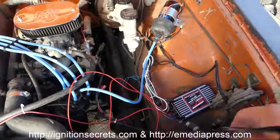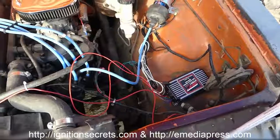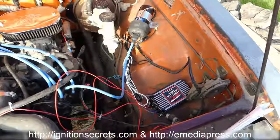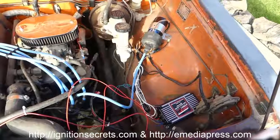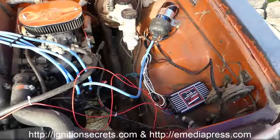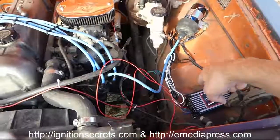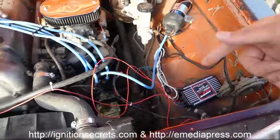And so what I'm going to do is take the cap in here, which is normally hundreds of volts, and normally it's thought to be impossible to jump this cap across a spark plug gap or any kind of gap, because 500 volts is not high enough to break the so-called dielectric resistance of whatever's at the gap. So that's why you need high voltage to be able to jump the gap, like what's coming out of an ignition coil. But what I'm going to do is route the capacitor through some high voltage ham radio switching diodes to the top of each spark plug.